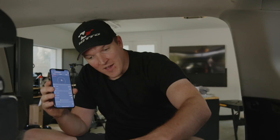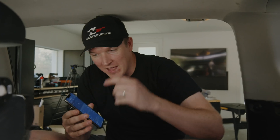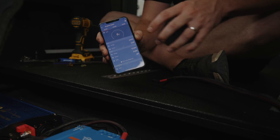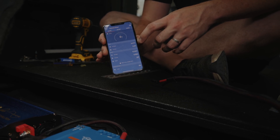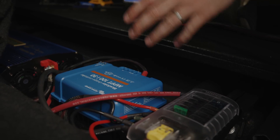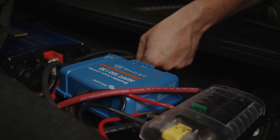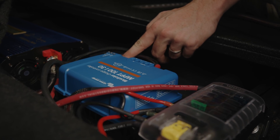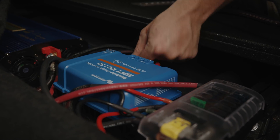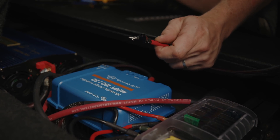At this point we have our MPPT solar charge controller connected to our battery via two six-gauge wires. We have the Bluetooth dongle connected to our app — we went with the optional Bluetooth dongle which allows us to see how much voltage we're bringing in and shows trends of power brought in over the past few days on the trail. Connect your solar charge controller to the battery first, update all the firmware, get everything right and the battery type selected. There is a physical very small switch controlled with a tiny flathead — it was hard to find info on this, but we found that number two is for AGM deep-cycle batteries. Click that to that, connect your dongle, and now we're going to plug in the wires we ran from the roof rack.